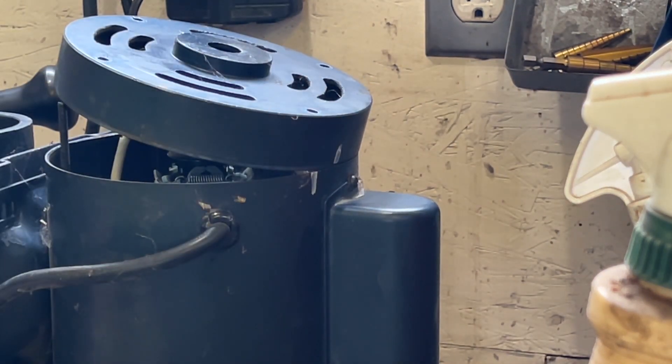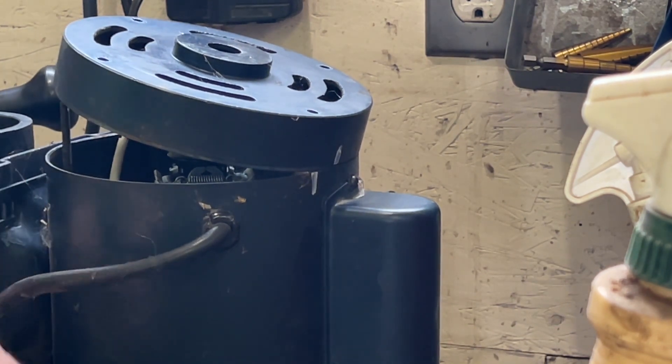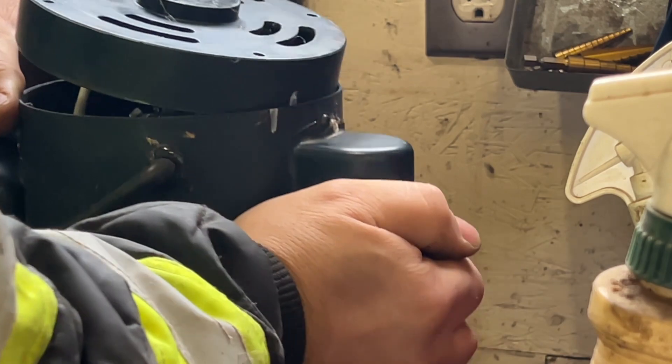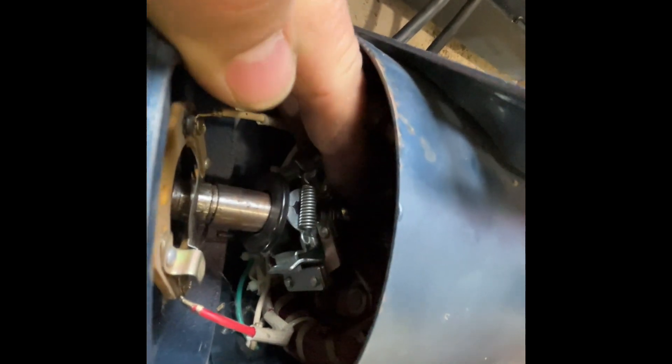That's a pain, I'm going to take it right off. I can hear my dog whining because I've got him tied to a chain in my shop - he's starting to wander out of the yard and I'm scared I don't want him to get run over. Vinny, you be quiet now. Okay, so here's the problem: it's a centrifugal rotating switch here, and you can see that it's loose - it moves up and down on the shaft.